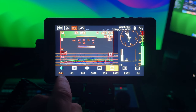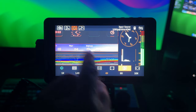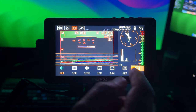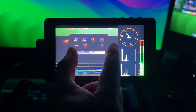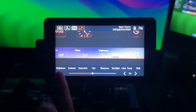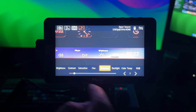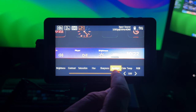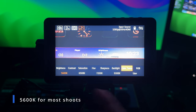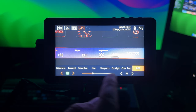You can set your full screen output — I've got mine set to auto with all output resolutions available. You can also zoom in up to 4x with a pinch-to-zoom feature, just like on a touchscreen phone. Moving on to the last screen, you've got all your monitor adjustments: brightness, contrast, saturation, hue, sharpness, backlight, and color temperature — I generally have mine set to 5600K. You can fine-tune the RGB values for reds, blues, and greens.